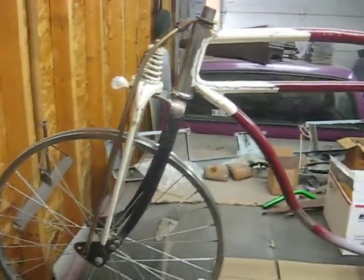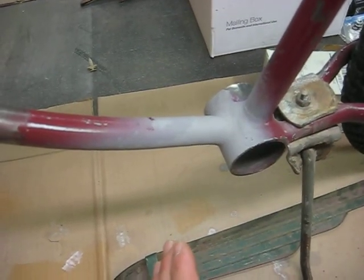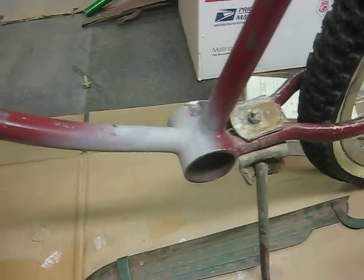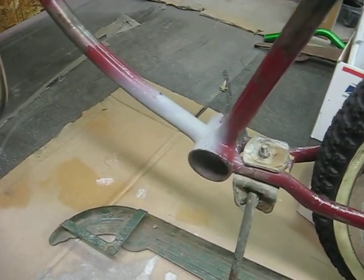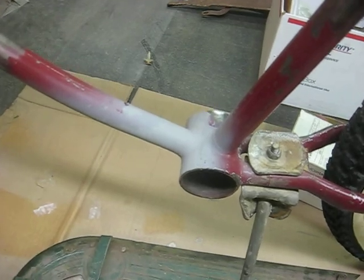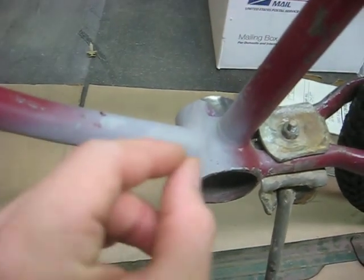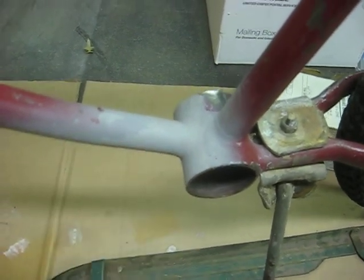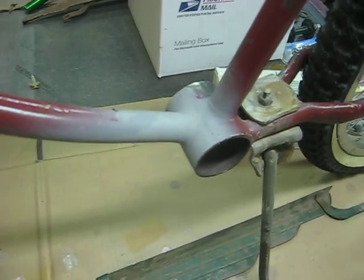There's still some more work to do. That crack down here has been repaired. I ran my grinder disc right through the crack to open it up a little bit and then welded it shut. That does a couple of things — it removes all the corrosion that has seeped into the crack and gives you a nice clean material to burn into with your weld. It also gives you a chamfer to lay the weld into so it's already lower and flatter, at surface level. Then I did some hand filing on it to the point that it's so smooth you really couldn't even tell it was ever there.